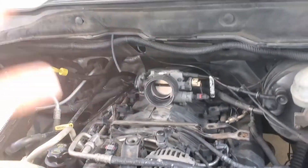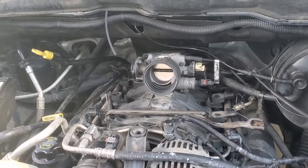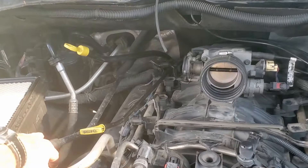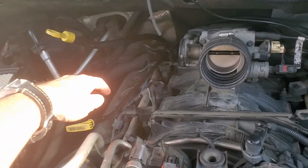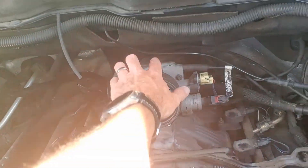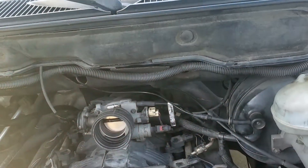You need to take off your air box, and if you want to know how to do that, in one of my other videos I show you — it's pretty easy. Disconnect over there, unconnect this hose, then unconnect the one connector to the mass airflow sensor, loosen this and loosen your bolts, and pull it right off.